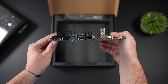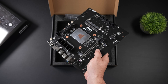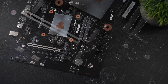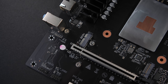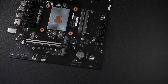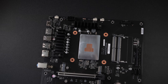When it comes to I/O, one thing that's kind of missing is USB Type-C. It would have been really nice if they added even just a USB Type-C 3.0 port around back. This board only supports SODIMM DDR5, but we do have a PCIe x16 slot — it's a 4.0 slot. It supports dual NVMe SSDs, and we've also got an M.2 E-key so we can add Wi-Fi and Bluetooth. It does come with an antenna mount. It supports a regular power supply with a 24-pin and 8-pin CPU power — you could go ATX or SFX.